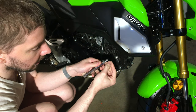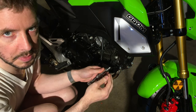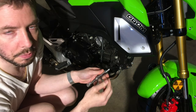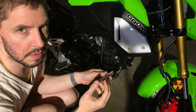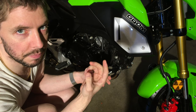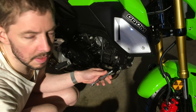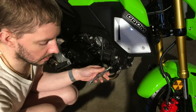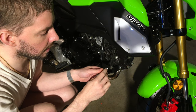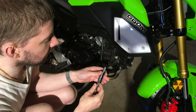Iridium has an ultra high melting point, so spark plugs with an iridium tip tend to last up to 10 times longer than standard ones since the iridium tip is resistant to electron sputter erosion. Every time the spark forms it's a high temperature plasma which can easily melt and ablate steel spark plug tips. Iridium's ultra high melting point enables the iridium point to last up to 120,000 miles in some vehicle engines.